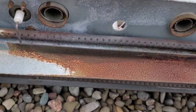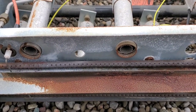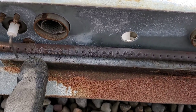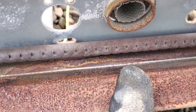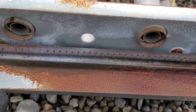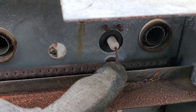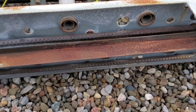The burner's out — pretty simple to take out. It's just a union, disconnect some wires from the gas valve, the flame sensor, and the spark igniter, and you can pull the burner right out. Here is the existing pilot tube, runner tube, and you can see why we might have issues with gas distribution. I'm also going to change the igniter, the sparker, and the flame sensor, because that's not in very good shape either. We're going to change all of those along with the tubing and get this machine back up and running.